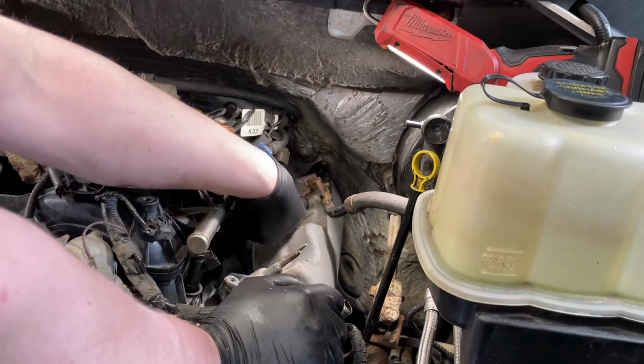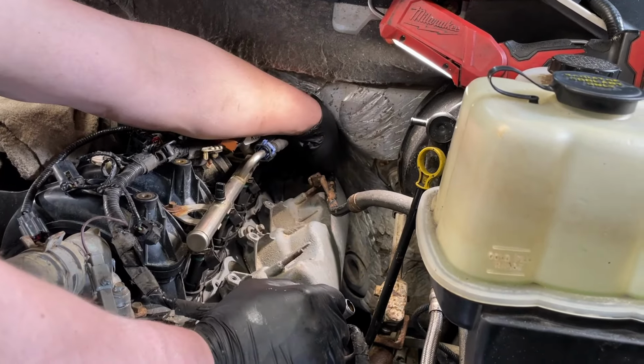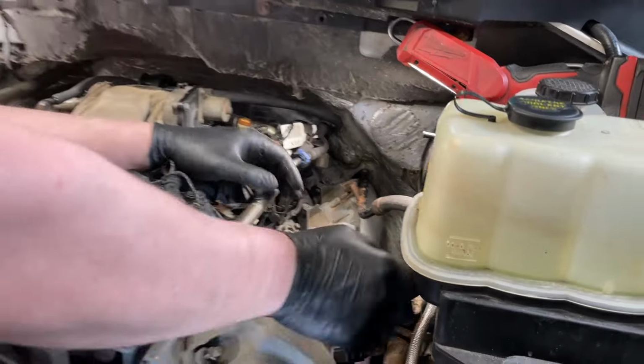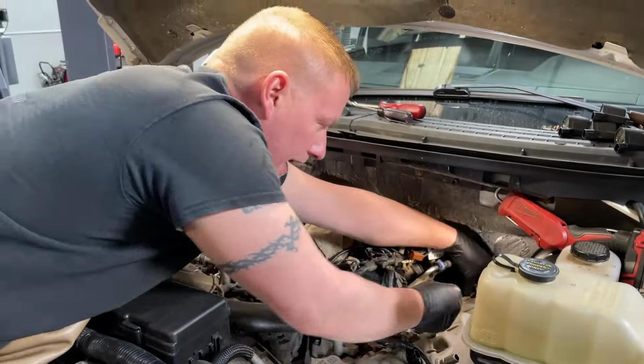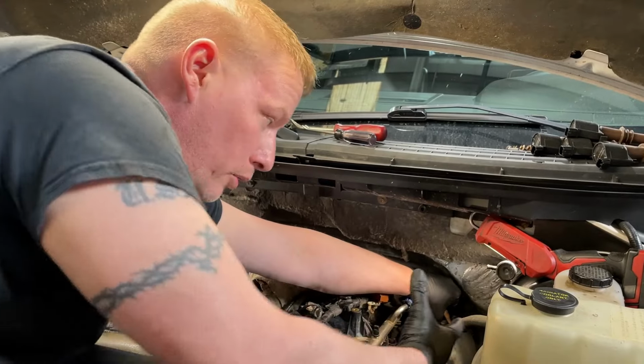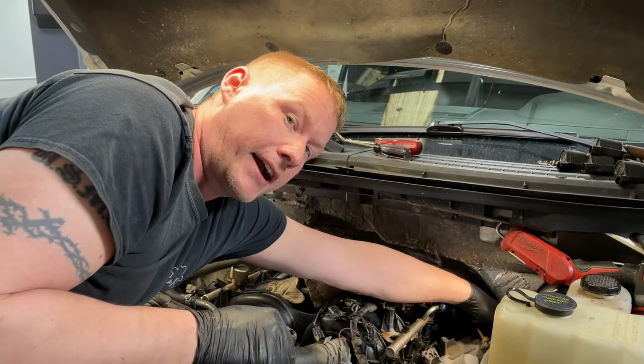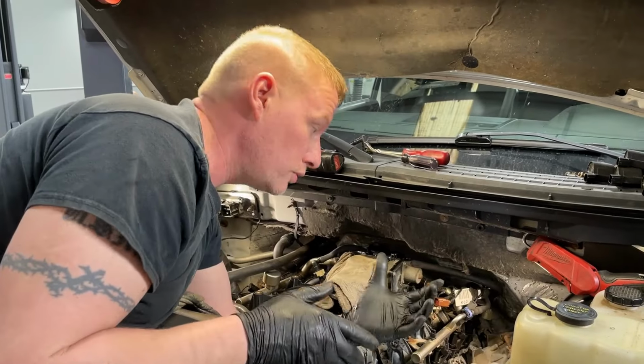this big old line right here is actually a brake booster vacuum supply line from the back of the intake. So it clips in right here on the valve cover, but it also clips in the back side of the head back here. What you want to do when you're pulling the valve covers off is just pry it up and off of the valve cover and then grab the valve cover and pull it out. You don't want to remove it from the bracket in the back of the head